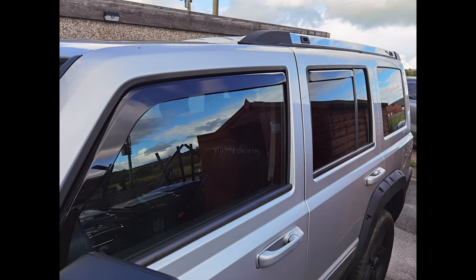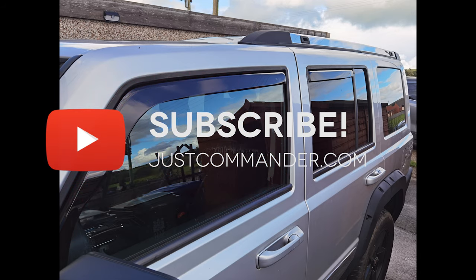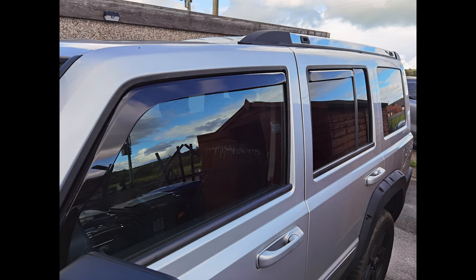Now repeat this process for the rest of the windows. On the front windows, insert the fat end first and then you have to flex the deflector by bending it carefully to get it in. Also make sure that the front deflectors are pushed all the way up — if they aren't, the glass can hit the deflector and won't go up. When putting the clips in, you must put one right at the front of the front deflector to push it away from the glass.